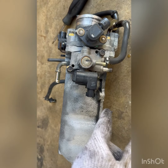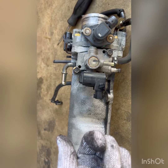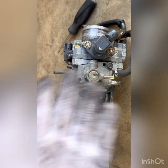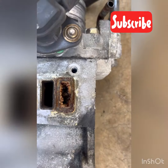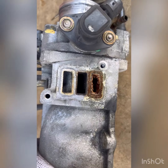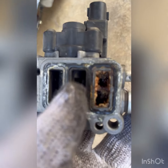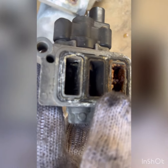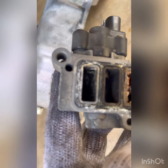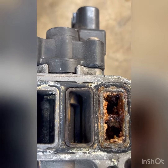So this is the issue right here — the idle air control valve code. We're going to take it off and take a closer look inside. It's all 10-millimeter bolts, so just take them off. Oh guys, it's a mess — so nasty in here. This center area is where water comes in to cool it down. We're going to check this area and clean it up. Put some WD-40 in there — it looks like it's stuck for real.